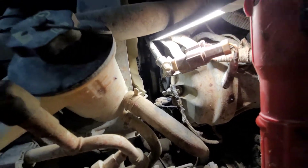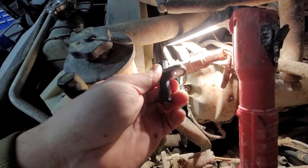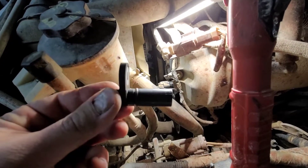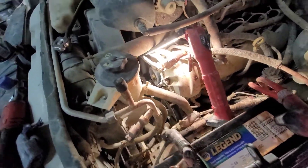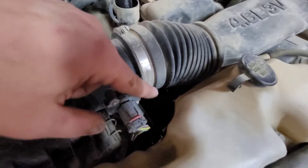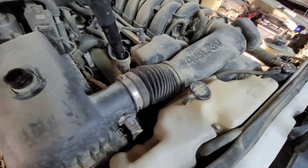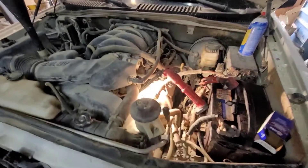These are not very expensive to fix. I think this sensor was maybe $25 at the top end from Napa, and you can get them cheaper online from Rock Auto or whatever. It's a super easy fix — just a single 8mm bolt, pop the old one out, put the new one in, bolt it in, and reattach your wiring connector. You have two of these, one for each cylinder head. Your bank 2 sensor is over here underneath the air intake — same location, just pull off your air intake tube with a worm clamp at each end and take your airbox lid off. It's the exact same part number for both sides, installs the same way — just a single 8mm bolt and a wiring clip.